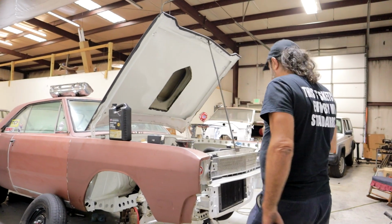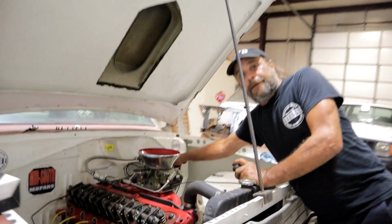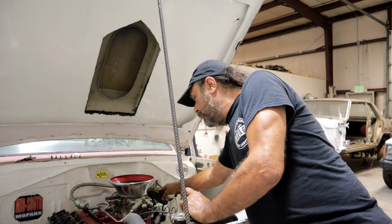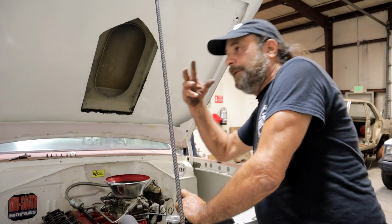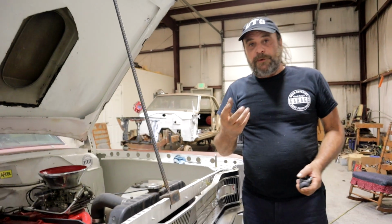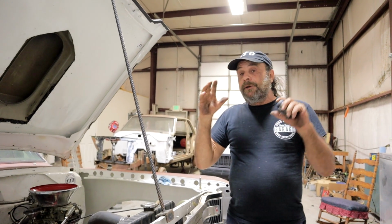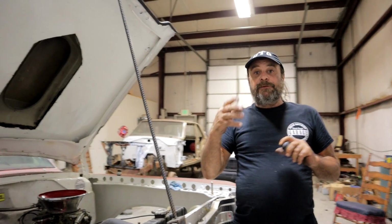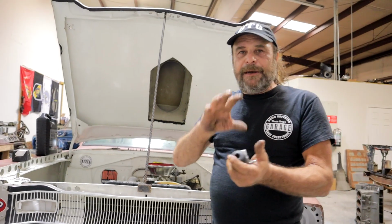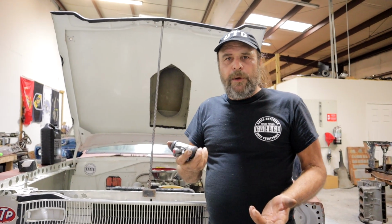So in this case, while the car sat, the gasket on the master cylinder here is bad, right? It's just a junk gasket, and so it was able to absorb moisture from the air as it sat. And then what happens is, as that moisture finds its way into the reservoir, the water molecules gravitate through the brake system, and after an extended period of time, after a year, 2 years, 3 years, that water will eventually all gather and congregate at the furthest points away. So in our case, wheel cylinder.